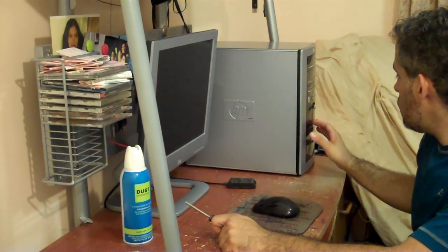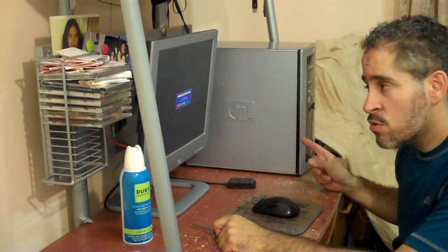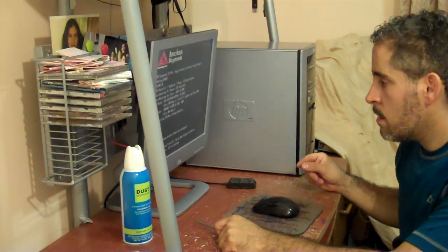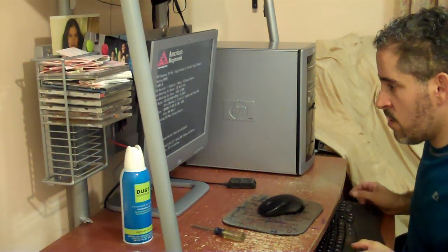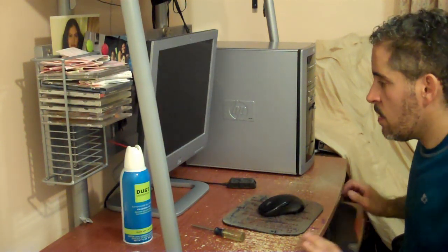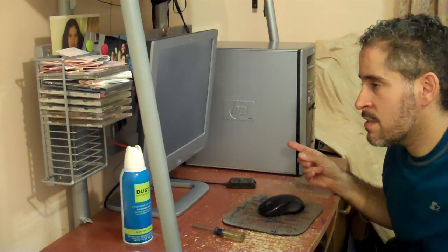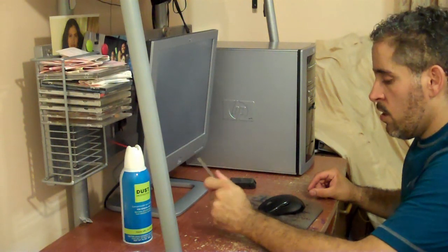This is what happened. I went to use my computer and it will not boot. As you can see it starts to boot and I'm going to get the click. After I get a click, it wants me to change my hard drive. It's going to try to boot up again — you can hear it trying to read and write, but it's not working. I got a black screen. So my hard drive is shot.